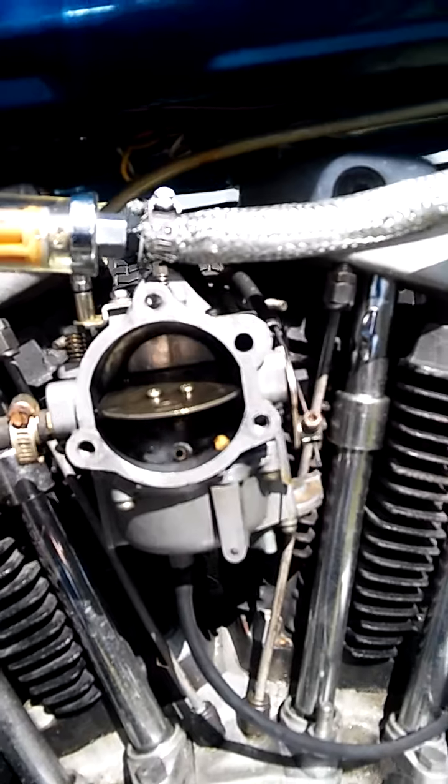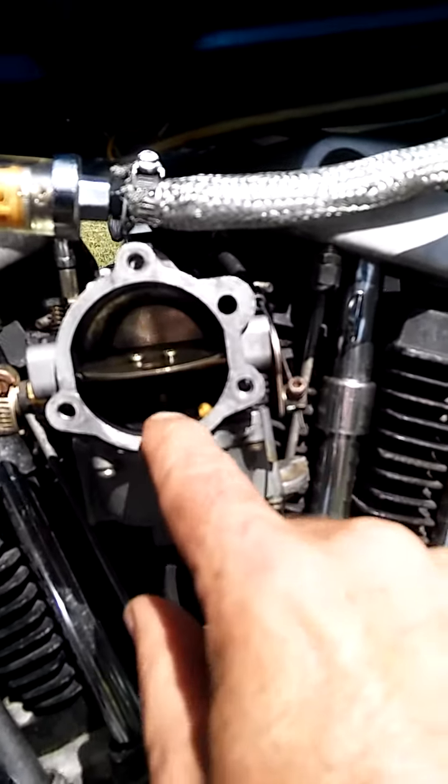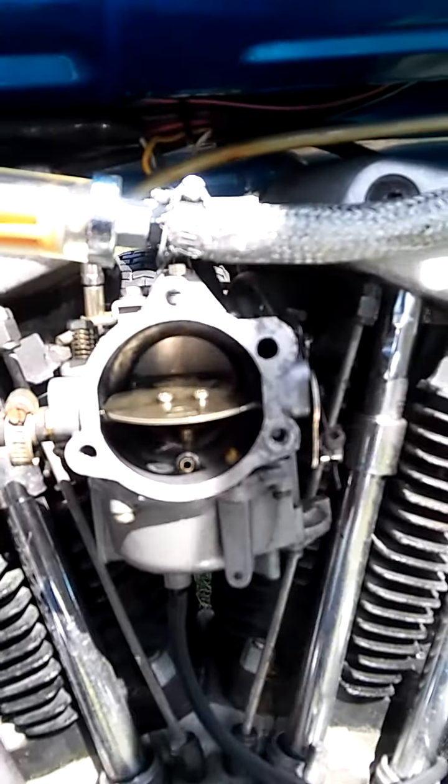I just choked it so I didn't have to go around. Right there you can see in the dead spot — no fuel is coming out of that primary. Right there. We got plenty of squirt in the accelerator pump.